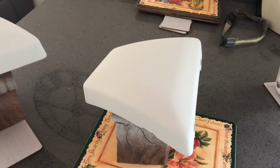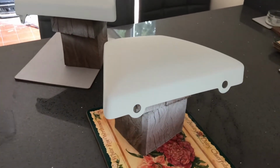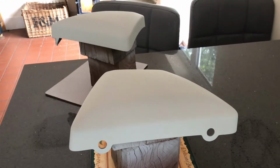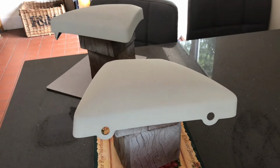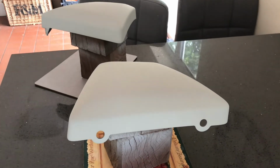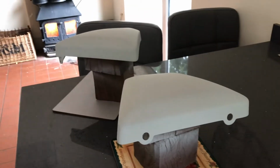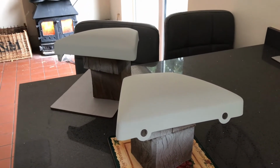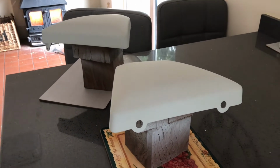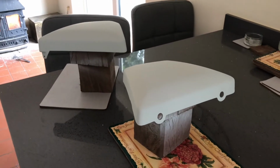And what the guy in the paint shop also told me was, it's absolutely vital that that primer be completely dry. I left it 15 minutes between coats, so it took just under an hour to spray them. And he said, leave it 24 hours at least. Somebody else in the shop said the key to knowing that it's dried is if you use your nose and sniff near it. If you can smell paint, he said it's not fully dried or fully cured.